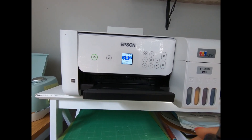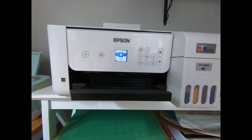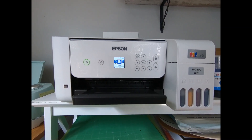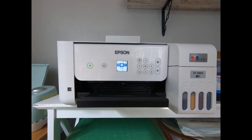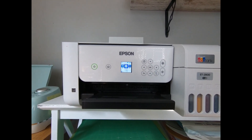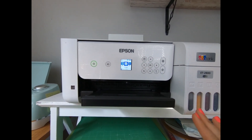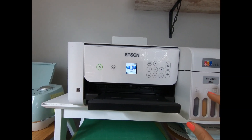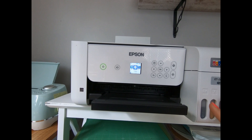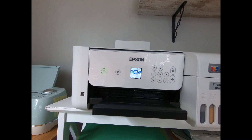I got the lines empty and then put the sublimation ink in and ran a couple of test prints, but it was not transferring onto the t-shirt. I literally thought I had ruined my printer. But I think what happened is the old ink was still in the lines even after flushing — it just needed to work through until the sublimation ink was actually pulling through. I tried printing over 100 things and it didn't seem to be helping.